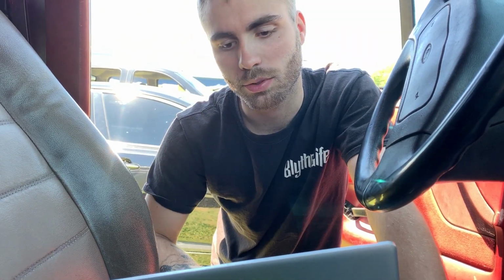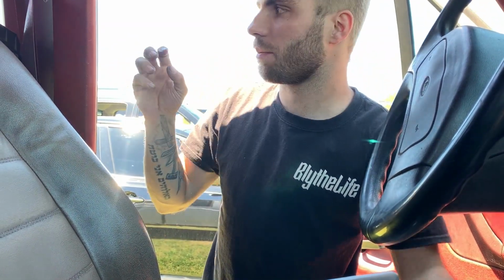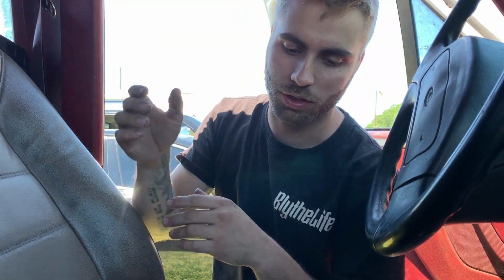The deal is, I was absolutely not prepared for what it did. It kind of scared me. And then whenever I was going down the track, I pedaled it again, and what happened is the blow-off valve on it isn't opening fast enough to relieve that pressure. So we've got a boost pressure spike in here. It thinks it's going really high in boost, but it's actually not. It's a lean condition in there because I don't have any extra fueling going in there because my throttle blades are shut. But I'm still at high boost pressure, is what it thinks.